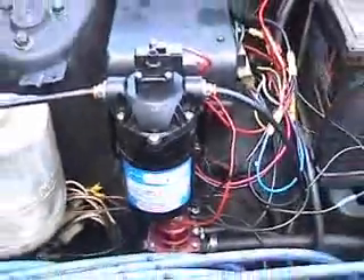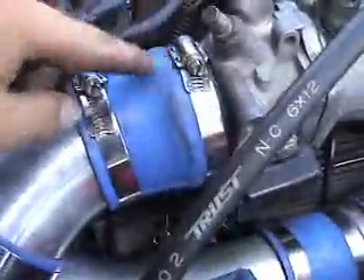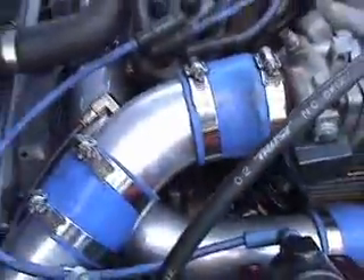I got my 240 front bumper on there and scooted my intercooler out a little bit. My latest project — the thing I think is just cool — is methanol injection, which I just put on. Excuse the wire mess, I just got it hooked up. Pressure switch is currently set at 10 pounds of boost. Here's the pump — it's a Cooling Mist system, 150 PSI pump — then a check valve, a flow and clog detector, and the line comes around to the nozzle right before the throttle body. It just shoots a mist and it's pretty badass.